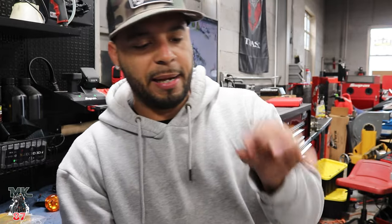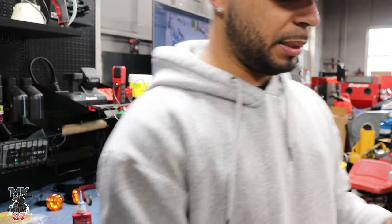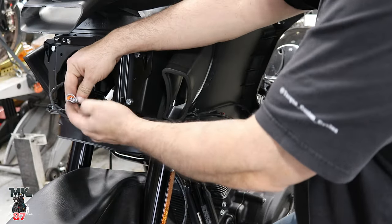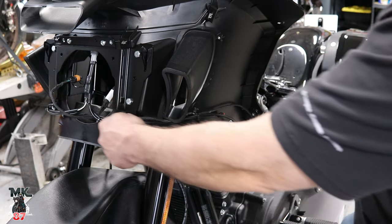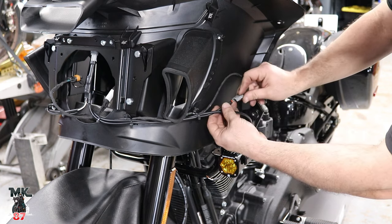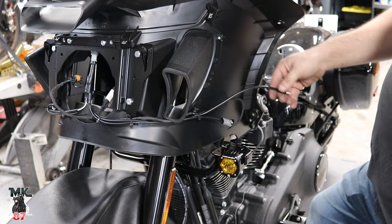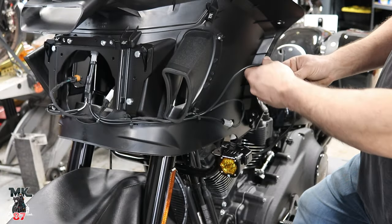The stock bolt you're not going to use — they provide a shorter bolt for the same place where you'd be screwing the original bolt. So this is the harness that comes with the S1s. This plug will tie into the main harness once we install that. What I did was I took their turn signal hookups and zip tied them to the factory wiring. Harley has it here — I popped that off and we're going to plug that directly into the Cali-Rays harness. And then this here we are going to splice into the main harness. Do you have to splice them or just solder them? I'm going to use their soldering splice connectors that come with it. I'm just going to trim it back a little bit and make it a little neater.